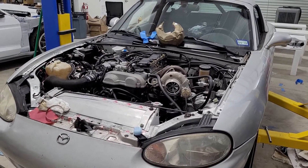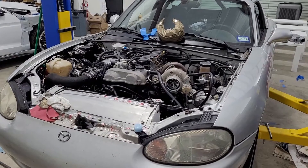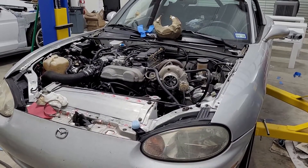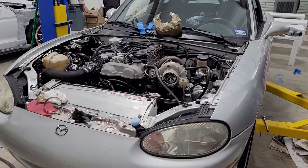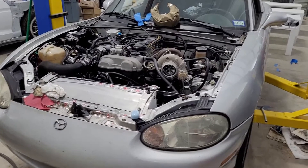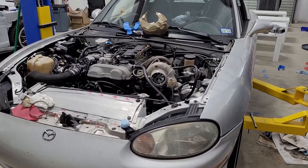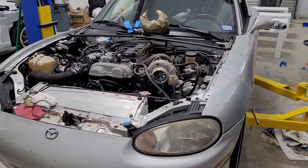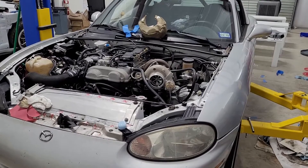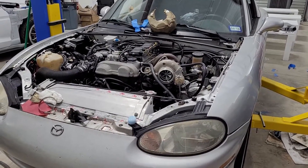Welcome back. This is my second video on compound turbos. In the previous video we talked about all the different turbos I ran on my compound setup and how they performed. Now we're going to talk about hypothetical stuff — what I think would have worked or what I think I should have done, but things I didn't actually put on the car and test. We actually ran four separate front turbos: the GT28, a GT3076 (which we killed), a different GT3076 after changing the manifold, and lastly the EFR 7670.